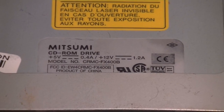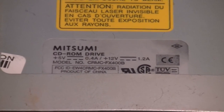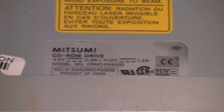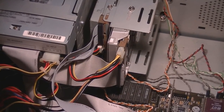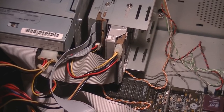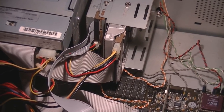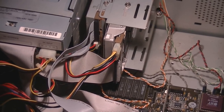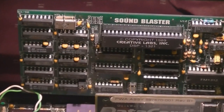As far as CD-ROM support goes, I'm using a quad-speed Mitsumi, though I might replace it with a Sony I have that's a bit older. The hard drive is a 1GB Quantum Fireball, it's IDE. DOS 6.22 is only detecting 512MB for some reason despite the BIOS being able to see the whole drive even in its own utilities. It might get replaced with a CF card at some point — this machine still isn't really finished yet.